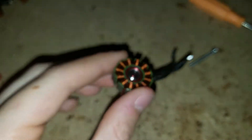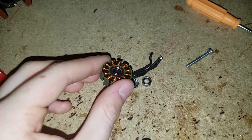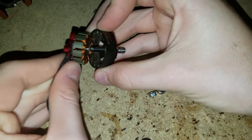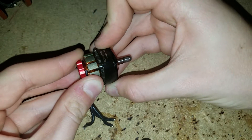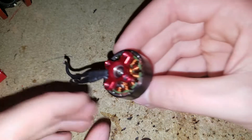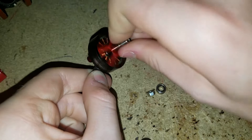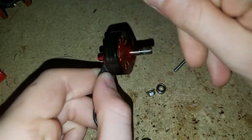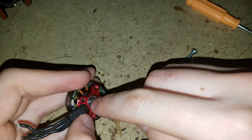I'll test fit the bell — the magnets make that a bit tricky. It appears to be fitting flush and sounds nice and smooth. Good success! Now all we've got to do is put the little washer and the screw back in, and don't forget to Loctite it. Our bearing is done being installed and sounding all smooth again.